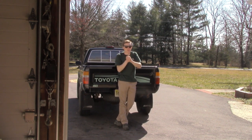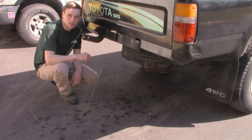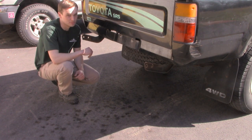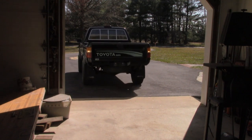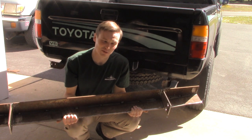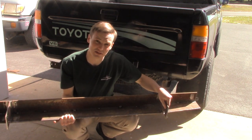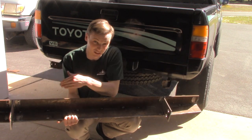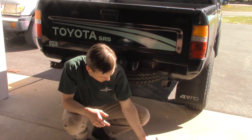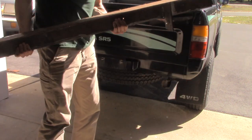Before I get ahead of myself, what's a super awesome truck without a super awesome bumper? So I made up this bumper kind of as a frame to begin with. It's really simple — just five pieces of flat stock, welded together in a T, and I'm just starting to build the face of it on the other side. It's still very boxy but we're going to work on it today.